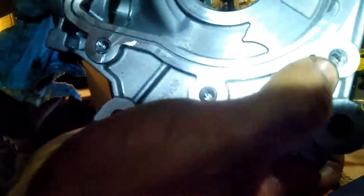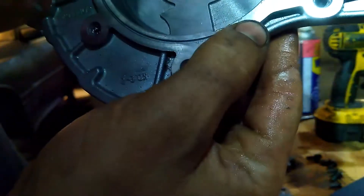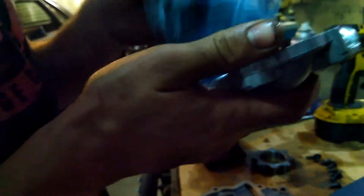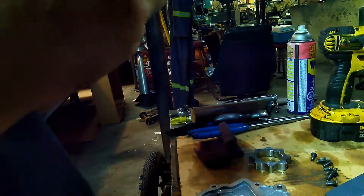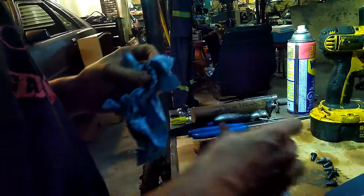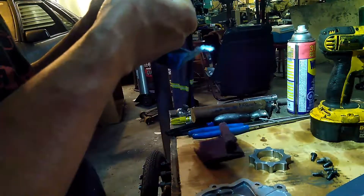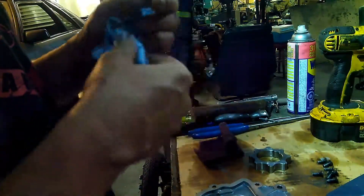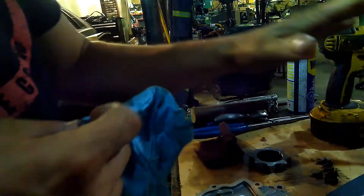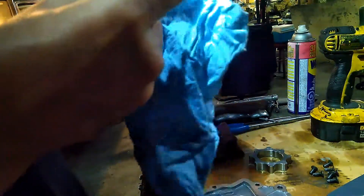One of the things I didn't like that I noticed is that I only took these out — I don't think I could have damaged the threads — but they were pretty nasty putting this thing together. So I'm gonna have to run a tap in and loctite them, which they actually weren't loctited, which is kind of weird because I always thought with an oil pump you always want to loctite that. We had a friend that bought a Nismo pump for his Skyline — which wasn't cheap — and they didn't tighten the fasteners, so his engine wasn't creating oil pressure because every time it pressured up it would just push the case out and leak everywhere. He took it apart and loctited it like it's meant to.